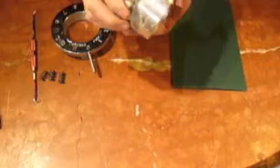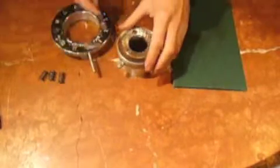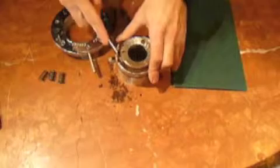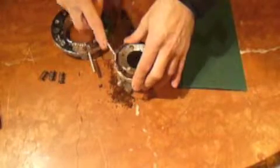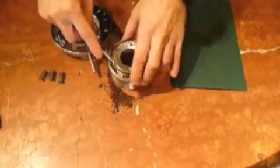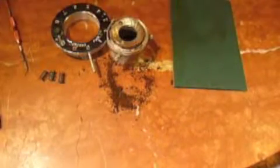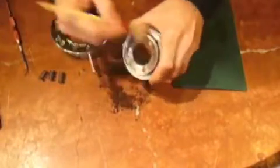Now, for the flange part, to clean the outside, use a pick. Try to not go on the inside towards the cutting blades, so that way you don't loosen the sharpness. And just scrape off the excess oils and coffee grounds that got stuck in time. There we are, everything just comes out nicely. Maybe use a soft brush, so you can clean a little better. Now we'll just vacuum everything.